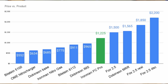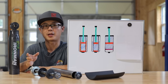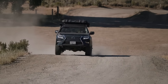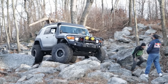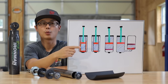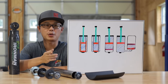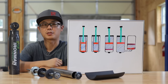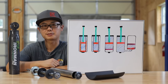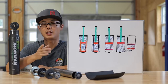If we compare the Foam Cell Pro to the more expensive stuff, the decision-maker again is whether you want to do high-speed off-road. Performance damping really comes into play where you have a lot of energy involved — when the suspension travels a lot in a short amount of time. For street driving, overlanding, and slow-speed rock crawling, you don't really need performance damping. When you go up in price, the other two features you start to see are remote reservoir and compression adjuster, which both help lower the shock pressure in a monotube. If you know you want to do high-speed, I will always go with the remote reservoir with compression adjuster. However, if you're not into high-speed stuff and just want a good quality, reliable shock, I will actually go with the Ironman over the Fox, even if you have more money to burn — simply because this has less maintenance.